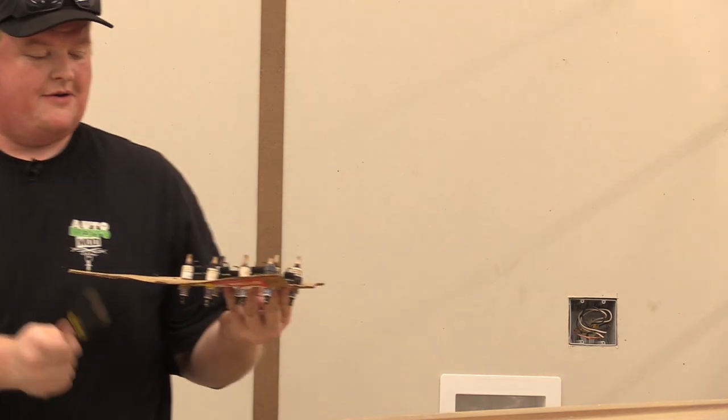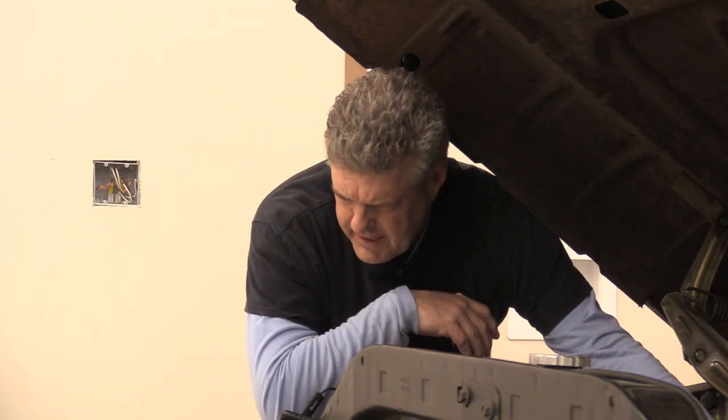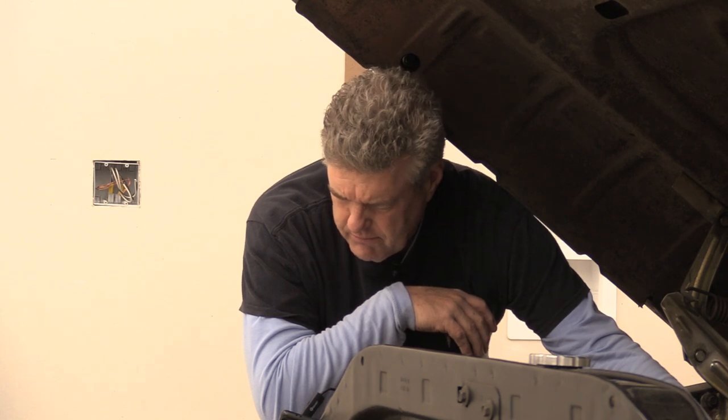All right, well, hopefully Jeff has still got his little stiffy thing going on. And we'll get a reading, look at this hole. Well, we'll put the borescope down inside of the cylinder here. The cylinder walls on this thing are pretty shiny, but there is still some evidence of cross-hatching. It's going to be kind of hard for me to show this to you because this thing is like trying to drive a mule that doesn't want to go where you want it to go.